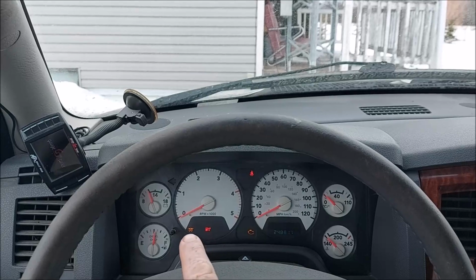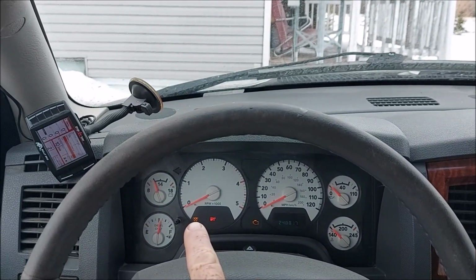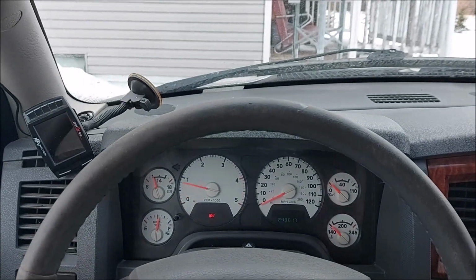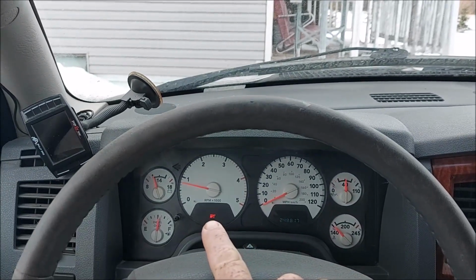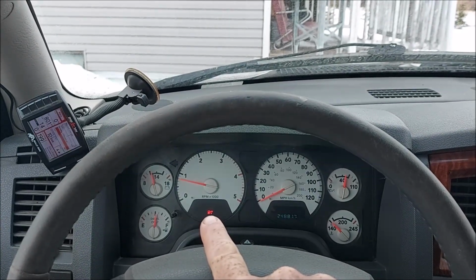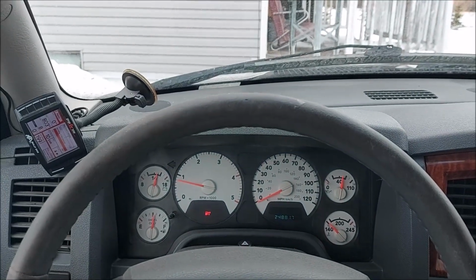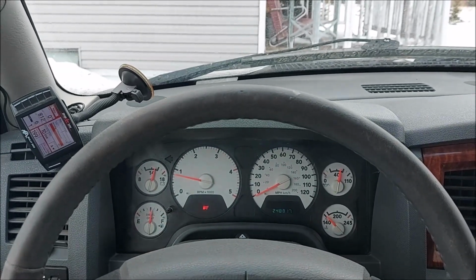So there's a big diesel, so you're waiting for the glow plugs here. It's not glow plugs in this engine. That's a misnomer. It's a grid heater. It looks like this is telling me there's some water in the water separator. So that's a good system to have, especially on a diesel engine. I'll service that once in the shop. I'm gonna have a tank of fuel, so that's worth about $200.